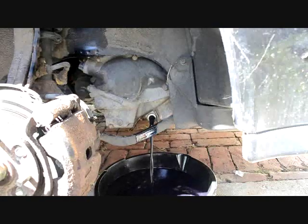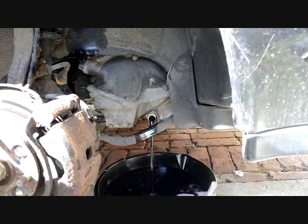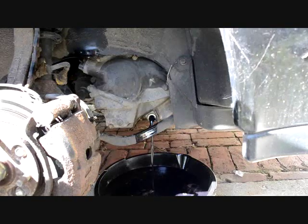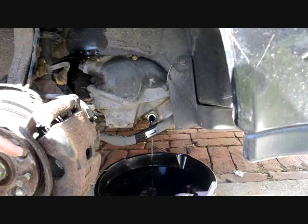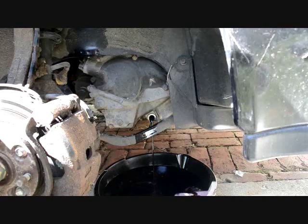So now this isn't quite a flush. Honda, from my understanding, does not suggest doing flushes at a regular shop. Maybe go to them. But you drain out about 3 or 4 quarts of fluid, just replace it, and then run the engine for a while.